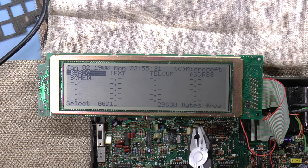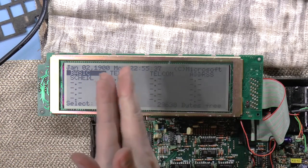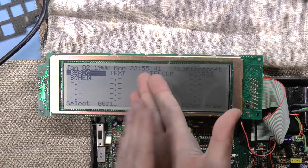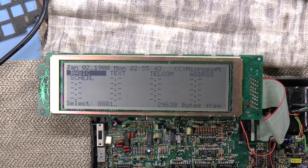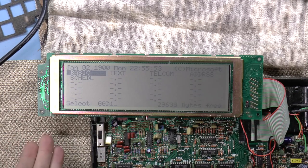So not too hard so that the glass would break, but you know, the idea is that the strip really needs to press up against the pad on the printed circuit board and the pad on the LCD. So if there isn't enough pressure just in that one particular spot, you won't get a connection. So it actually looks like it works.